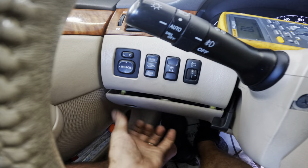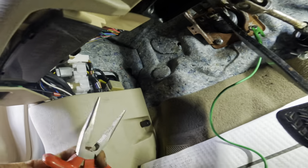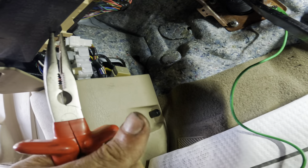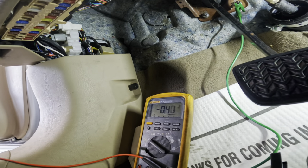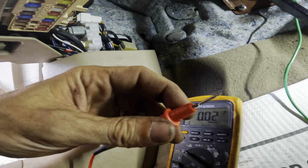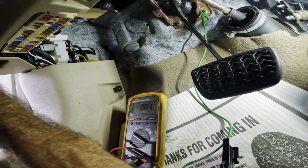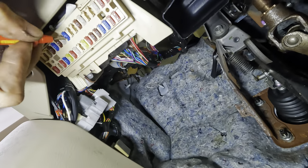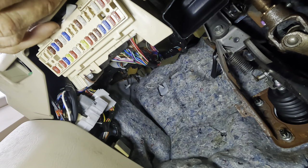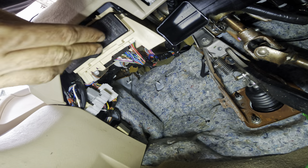Okay, down to the fuse box. We're going to check some voltages at the fuses, which are located right inside here. I'm clipping a ground wire to the negative on the meter and switching it to voltage. I'll use the positive probe to probe the little pins in the fuses, checking the micro fuses to make sure that none of them are open. Going through and probing each one of the access pins one at a time — well, that's not it. It's not a fuse issue.